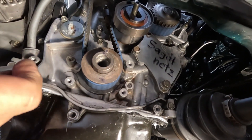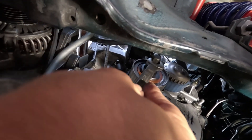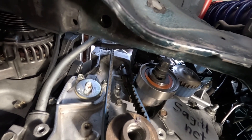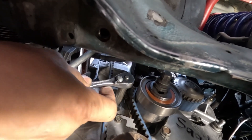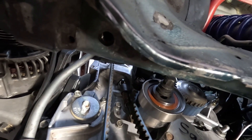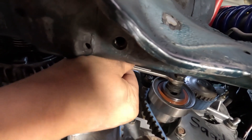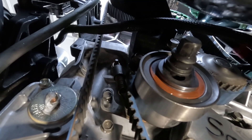Once you are satisfied on how your initial belt is put on, make sure the nut is tight. I'm going to loosen my maintenance bolt. Since my spring is already installed, all I need to do is loosen what they call the maintenance bolt and loosen the nut, and you are going to see that the belt tensioner will go up — the tension of the spring will pull it. There you go, you see it move.